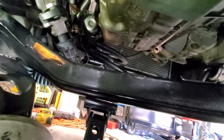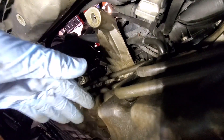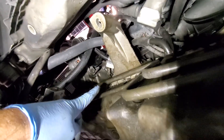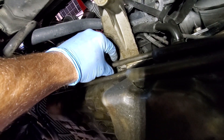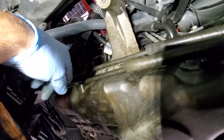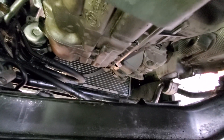The reverse is true when you're going to put this pan back on. When I put this oil pan back on, you're going to place the new gasket on top of the oil pan, and then I took — in four spots through the bolt holes — some real small zip ties and zip-tied the gasket to the pan, two in the front corners and basically two in the back corners. Because when you're sliding this thing back in, it's a devil to get the pan where it needs to be without the gasket sliding off. That's what I did there.